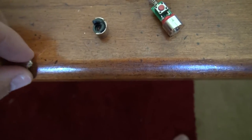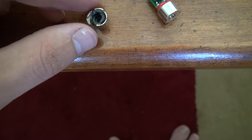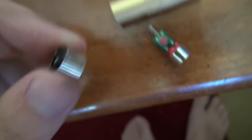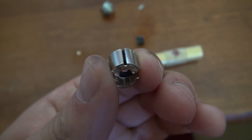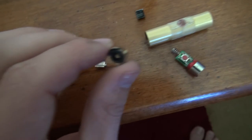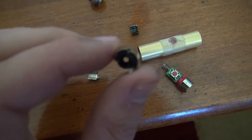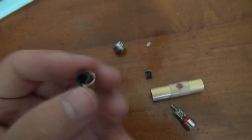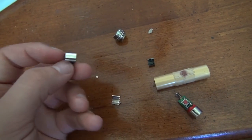Then what you're left with is a round unit. I've cut pieces off of it here — it should be nice and round like that. Cut smoothly and easily just through the side of it, gently. You can see I didn't go all the way down, just until you hit the black plastic ring inside, which is what is holding the lens. I had to cut it about three times until I could pry it apart and get the center part out.